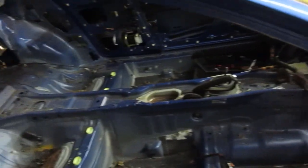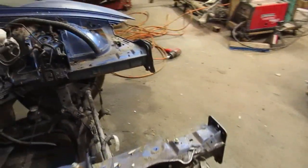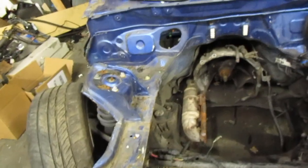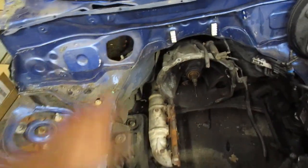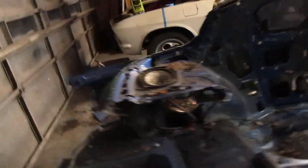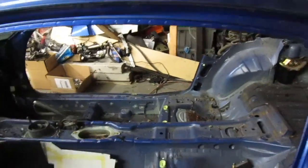With it all torn down you can see why this is such a good chassis. It's mostly this center rib — the frame rails start out here, curve in to the trans tunnel, keep going with the center rib, and then flare out. This car has a huge opening — it's basically a four-door car but it has no B-pillar. Open both doors and it's just a huge opening, which means they needed to stiffen it up significantly.